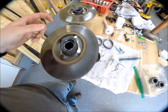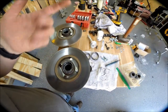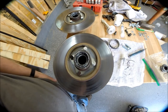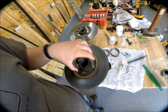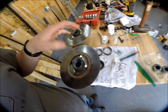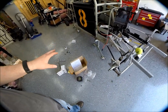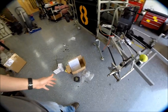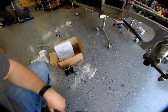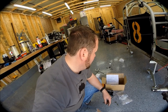So: DRP bearing spacer in, bearings in, put the seal on, and then assemble the hub. That's when I put the disc on the hub and bolt it down. I needed a couple of new bolts since I was using some old crusty, rusty hubs. Before I can completely mount these on the spindles, I've got to start mounting my Wilwood brake kit. You can see the Wilwood brake kit — I've got half of it here because the other half is on the other side of the car.